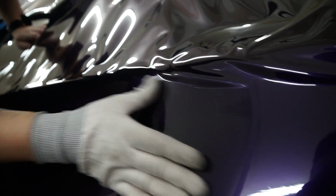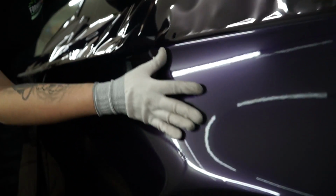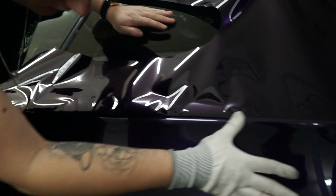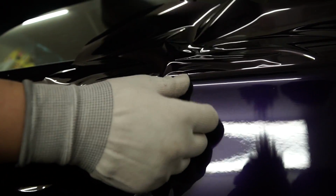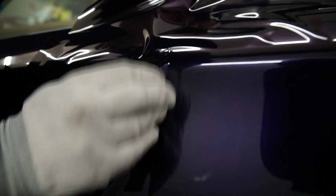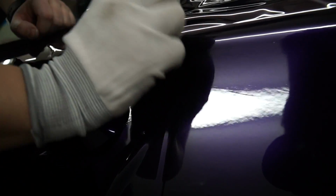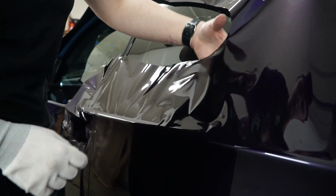Okay, just slowly start moving the material out from the center and to your corners. Okay, there we go. Just like that. Normally, you'd want this portion to be stretched outwards so that it can lay. With VinylFrog, because it shrinks in on itself, it's fine as it is, because when I heat it, it'll just suck right in on itself and lay in that little groove. Now, kind of keep tension on some of these parts.